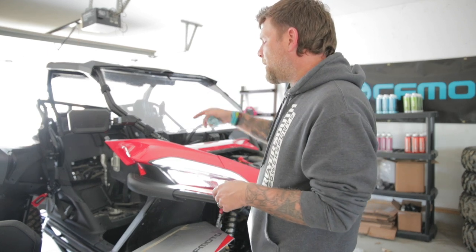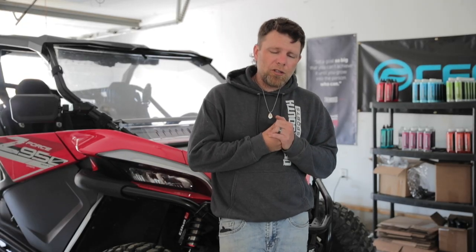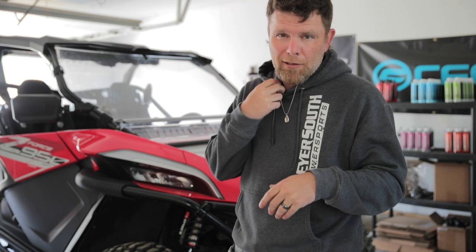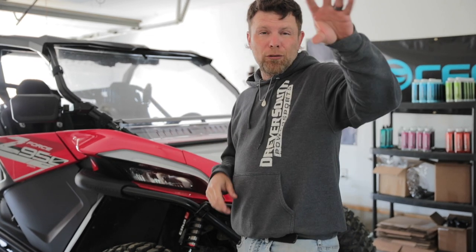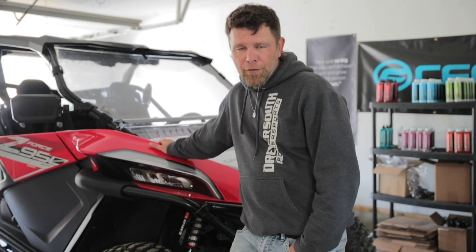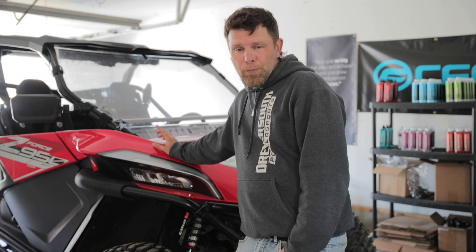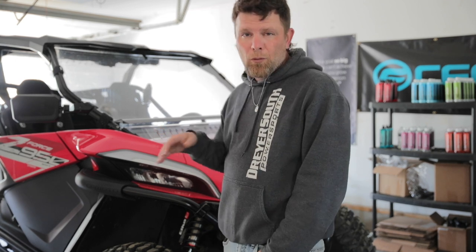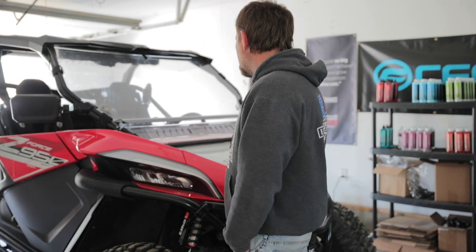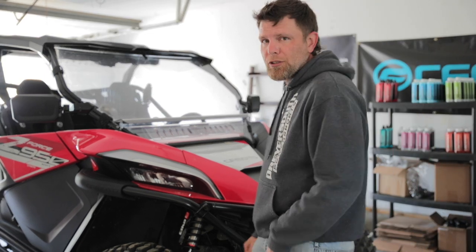I'm going to put the seat back in, the panel back on, rinse everything off, and then we'll wrap it up. And there you have it — it's just that simple, just that easy. I do apologize for the audio in today's video; my usual mic is dead and I just have a little cheap mic on top of the camera. I let it sit, come up to temperature, waited for the fan to kick on, made sure it cooled back off, then pushed it outside to rinse off everywhere the antifreeze had gotten. I started it again outside, let it run, made sure the fan kicked on and back off. Everything is working flawlessly — it's good to go.